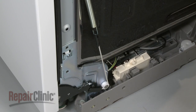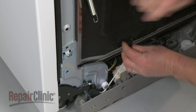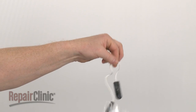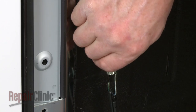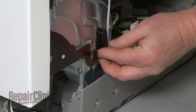Next, pull down the spring to release the tension on the hinge rope you're replacing and detach the old rope from the spring and hinge. Install the new hinge rope by first hooking the appropriate end onto the spring. Now, pull the spring down, loop the rope around the pulley, and hook the opposite end onto the door hinge.